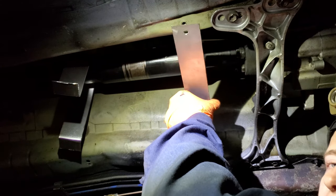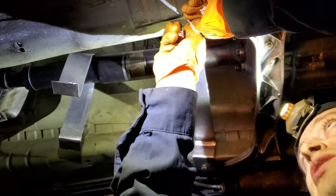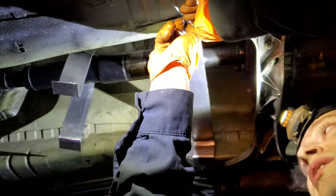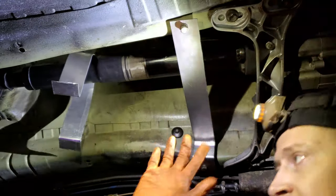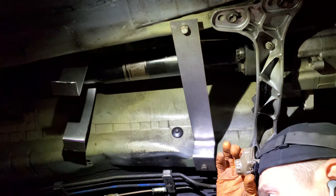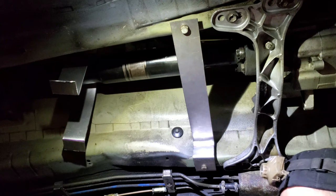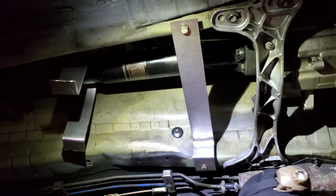Of course it's metric 13 on both sides, which makes it much easier. The reason I chose metric 13 is simply because everything down the line of the car is on 13s, so if I have to pull the drive shaft for any reason and get this free — bam — one tool for everything. That's why 13 is our number one.